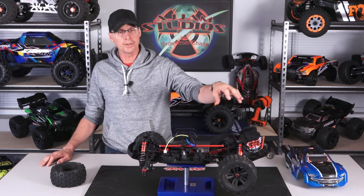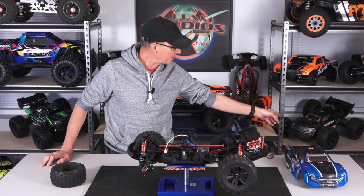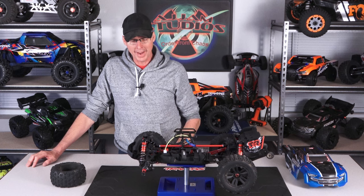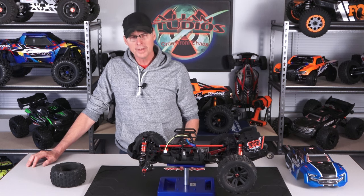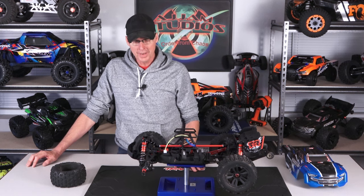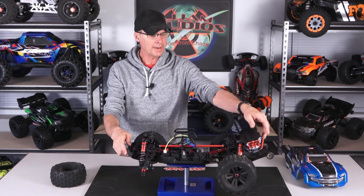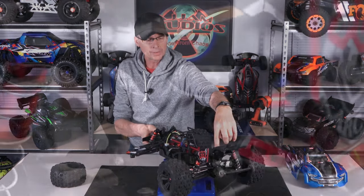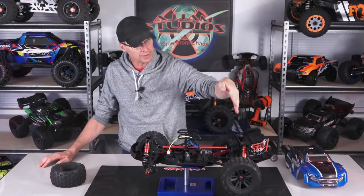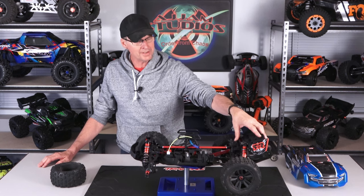And being that this is a version 4, it had the older style arms on it. Now, the EXB, which is sitting right down here, has the version 5 style arms on it, and you know they're a little more durable, but we still had problems with that too. So that's an issue that we had to deal with. Still, with the version 4, these arms are designed for it, and on the wing back here, it has the RPM wing mounts right here, which are a lot more limber. They'll take more impact without imparting pressure to the inners of the car, which causes problems in the long run. So that is a beautiful upgrade.